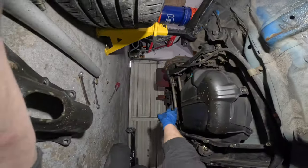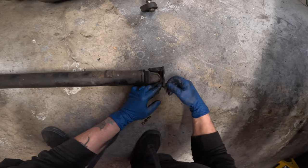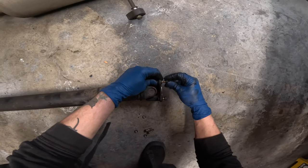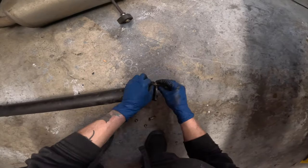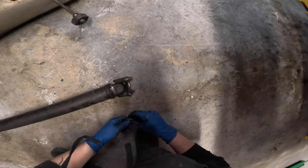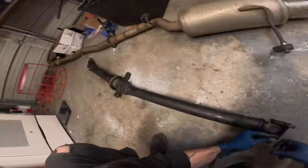Let's see what's next down here. I need to start attacking all of the suspension components. I personally like to put my hardware back on whatever piece it came off of to store it, because then I know I won't lose it. When it doesn't make sense - like if I have to refinish the part - I put it in plastic baggies and label everything. But if I don't have to go through that extra step, I prefer to just do it this way.